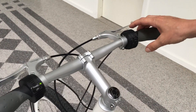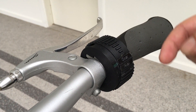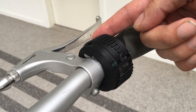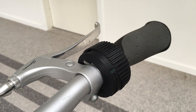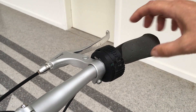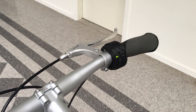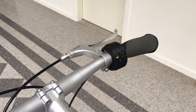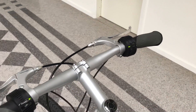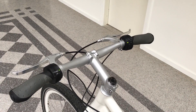On the other handle you have the gearing, and the gearing is electronic and also stepless control. Right now it's on the lowest gear and you can turn it stepless until the highest and set that in between like you like. There's also a possibility with this click — you can put it in auto mode, and then you also have cadence control, so the system will control your gearing and keep you on a specific cadence, like for example 60.